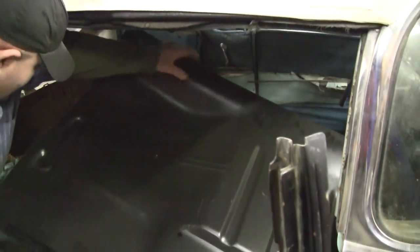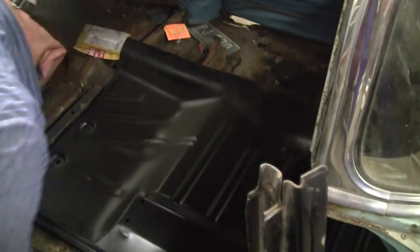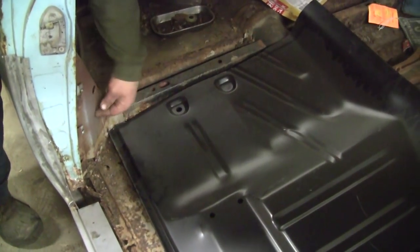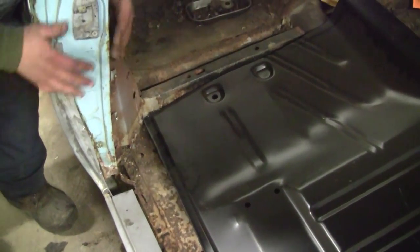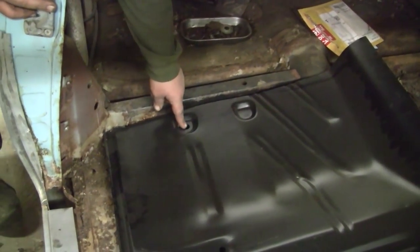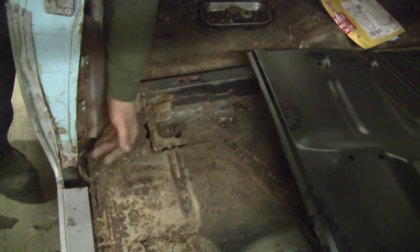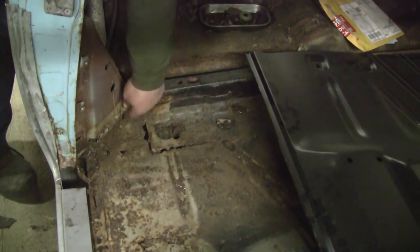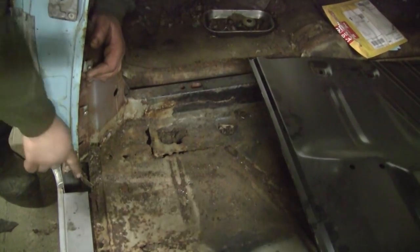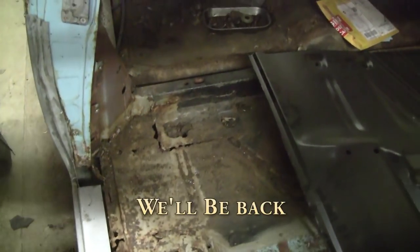Always be very careful — you don't want to cut yourself, nor hurt anybody or anything around you. As you can see, the floor is meant to go to the end. This car has a brace which supports the pillar and supports the floor. As our floor comes down, I have to measure from the center hole on the car to the edge with an angle, which I have a tool to square. I'll mark out where I need to cut and taper off to the end so we can make our floor. We'll weld little pieces in after, but we want to get a rough idea of where we're going first before we cut it all out.